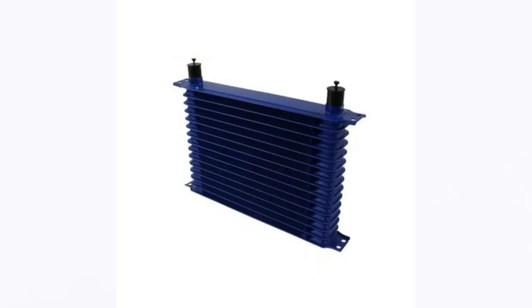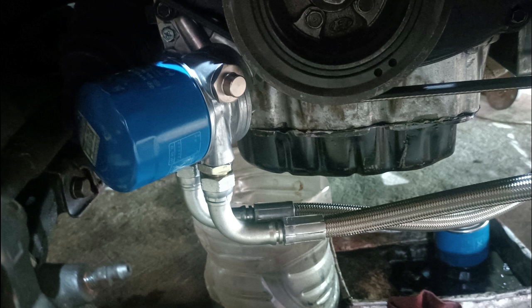And speaking of cooling, we have a 15-row oil cooler. This allows us to keep the oil cool as and when needed — 15-row is a lot of oil cooling capacity, so we should not be worried when we drive the car hard. To link the oil cooler and the sandwich plate, we have used stainless steel braided oil cooler lines. These are durable and flexible, but they tend to chafe body parts and plastics quite easily, so you have to make sure they don't touch anything, or wrap something around the hose to prevent chafing. These are very good hoses, custom made for our application.